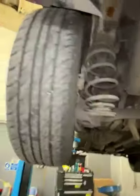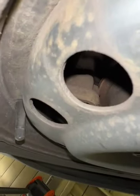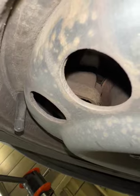As we come to your nearside rear tire, we have a central measurement of 6.16. Your rear brake pads are on about 30% life left — a little bit hard to see, but I'll get an angle for you. The rear discs are slightly lipped.